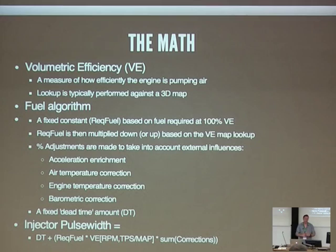There are potentially many other adjustments to take into account: things like rev limiters, run lean protection where you cut the spark if something's gone wrong, over-boost protection, traction control, and launch control. There are many other things an ECU can do to vary those numbers, but those are the typical ones for a normal case.